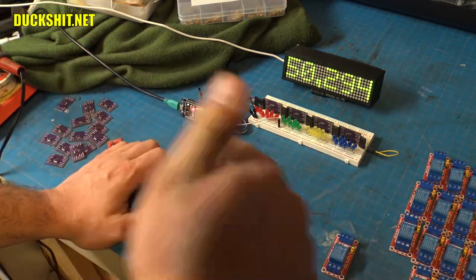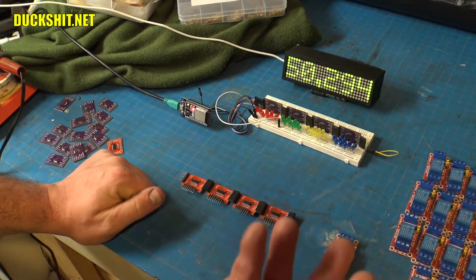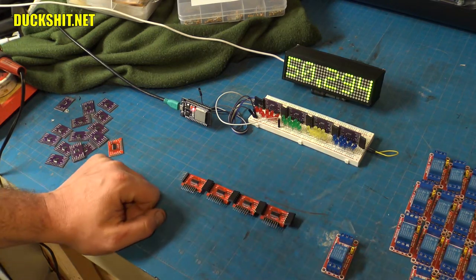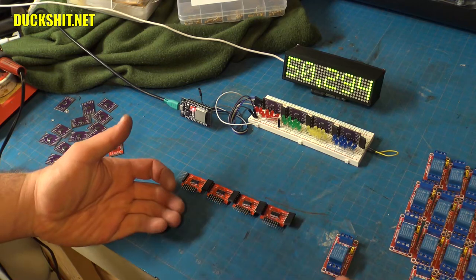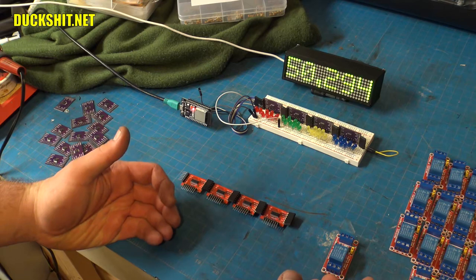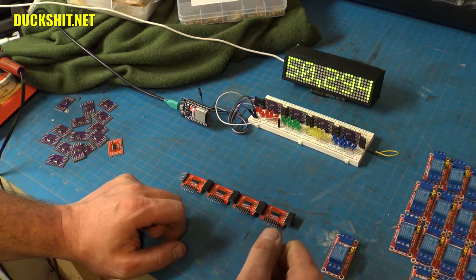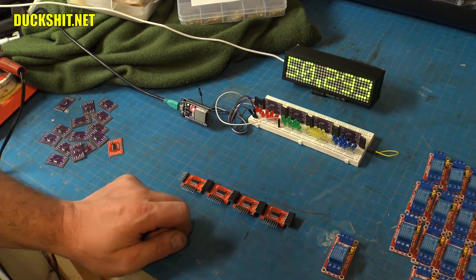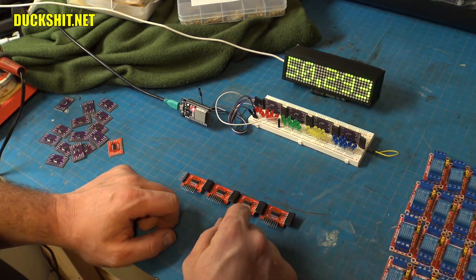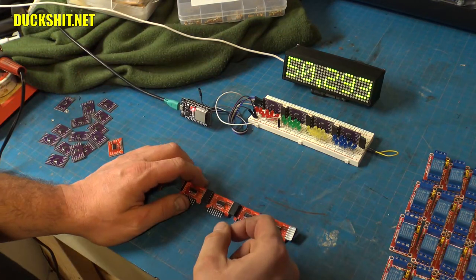It's also going to have a bunch of push buttons on the dashboard for turning on things like the fuel pump, the ignition. Of course, the ignition never could be turned on independently, but now it can be. And I kind of like that because when you're sitting in the car, if you turn your key and you leave it on, what happens? Yeah, anybody that's owned a Volkswagen before knows what happens. You fry your points. Hopefully they're in the open position, otherwise they're going to just burn themselves up. And then when you go to start the car, guess what doesn't happen? That's right, the car doesn't start. Electronic ignitions are not immune to that either. Electronic ignitions don't like to be sitting without the car running. So I will have the ability to boop, hit the ignition and turn it off.